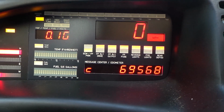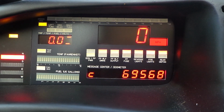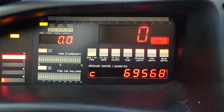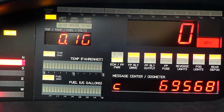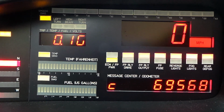DM2, I said what that does. That's changing the 4-digit display. See, I've given this so many functions that I've forgotten myself what they do now. Okay, that's fuel display. That character at the end is not a faulty display. It's supposed to represent a G for gallons. That's the best I can do on a 7-segment display to represent a G.